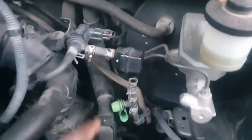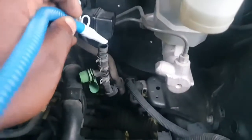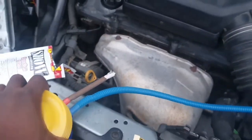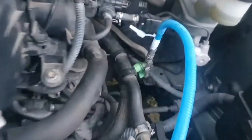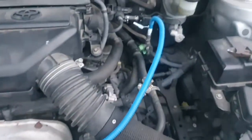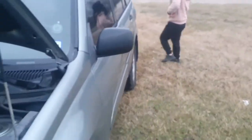I'm removing the hose from the purge valve side and replacing it with the portion that goes down toward the gas tank. Now I'm inserting the pump into that hose. Our cigar is doing its job. I'm pumping and looking for smoke. I still see no smoke anywhere here. Let me ask my assistant — can you check to see if you see any smoke on the side of the car up near the gas tank?